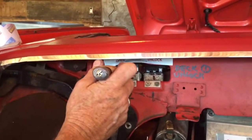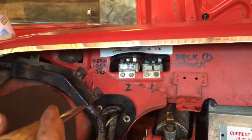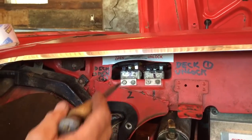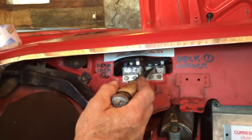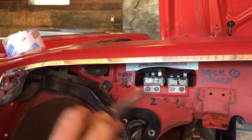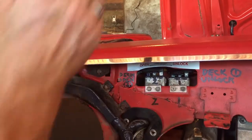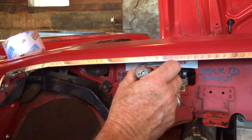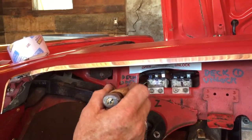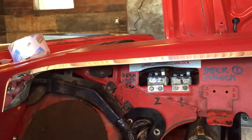This is the simplified way of opening a deck lid on a Lincoln Convertible. The book calls for fabricating a jump wire and removing the relays — this is the simple way to do it by bridging the marked terminals. This center terminal always has power on it; it doesn't matter where the key is. That one always has power. This one goes to the unscrew motor directly, so all I'm doing is hotwiring it and it unscrews.